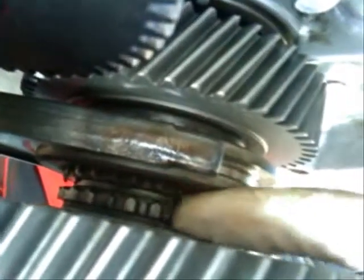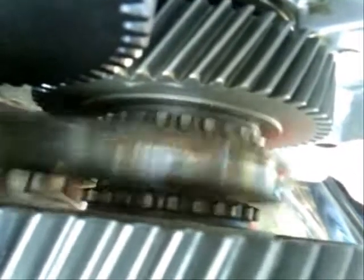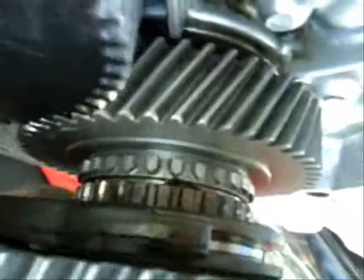Getting a bit upside down here. See the teeth? They look like the synchro rings on the transmission — that's part of the gear there. And that middle teeth right there, that's part of the shaft — the main shaft. As you can see, the selector just slides right up there while you're selecting it. Then there's the high gear.